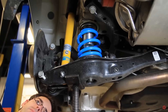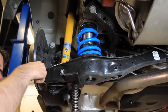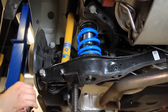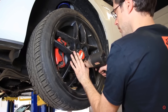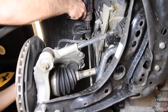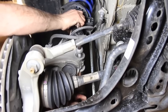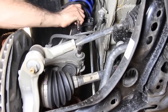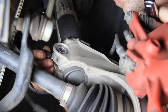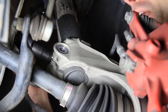We already have a full DIY on how to remove and replace complete suspension, which we showed in a coilover video linked in the description below. A brief overview: you will need to get your vehicle on jack stands, remove your front wheels, loosen the sway bar end links with an 18mm, and use a triple square and 18mm to remove the pinch bolt on the steering knuckle. Then use the strut spreader tool to open up the knuckle to allow the strut to slide down.